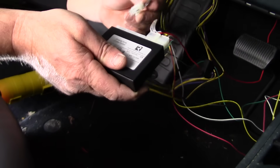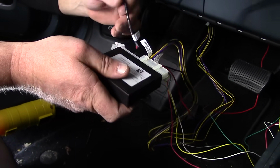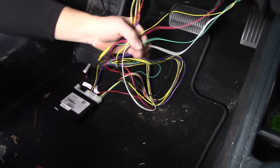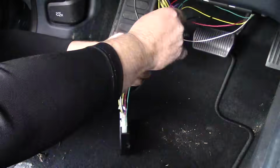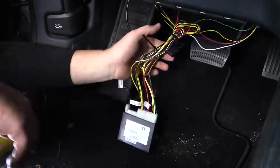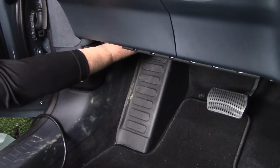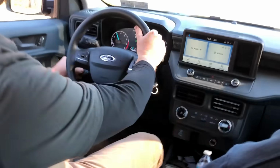Follow the instructions to connect the cruise control switch, OBD-II data harness, and accelerator pedal interface harness to the included cruise control module. Neatly wrap the bundle of wires for the cruise control system and use cable ties to fasten the wires and cruise control module behind the knee panel or the dashboard. Cruise control installation is now complete and the vehicle is ready for road testing.